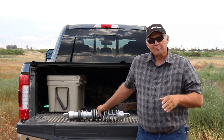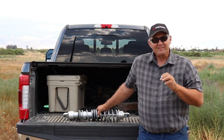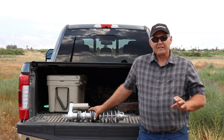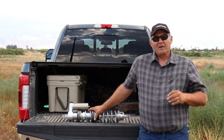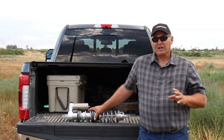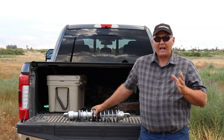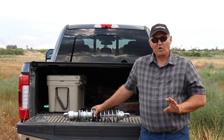After doing the spring kit, it was a really big improvement, as you've seen in another video that we did about the spring kit. But I was just lacking that little bit that I wanted. So again, I contacted Walker Evans, I talked to Reed. Reed suggested that a performance valving be done to my shocks. He also talked to me about a shock that they're building that's relatively new, that is a 2-inch shock with the larger shaft in it out of a 2.5 and a larger reservoir, which would make that shock act more like a 2.5 but still be the same shock that was on your car.